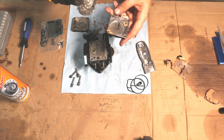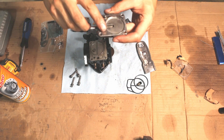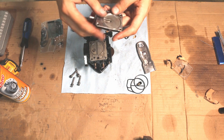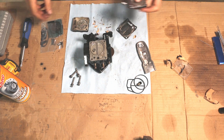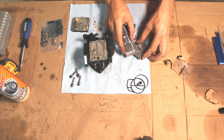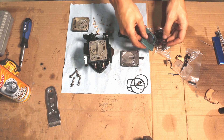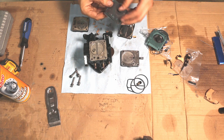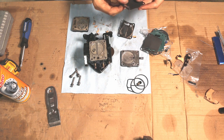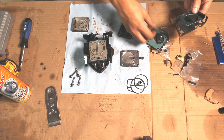If you're using a wire wheel, don't go too deep — just go until the paper is coming off. You can see I just gently went at this, didn't rub down any of the little ridges, and left a little around the alignment pin. Just smooth it up and get all that garbage off of there. Then you can take a razor blade and get the last little bit. Pulling all our parts out of here, what we're going to find first and foremost is this little plastic piece, and then a gasket that will match that.